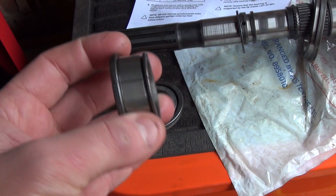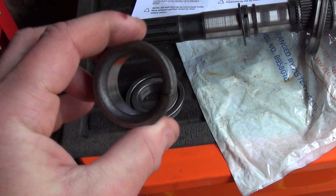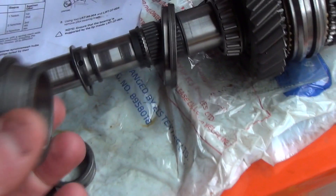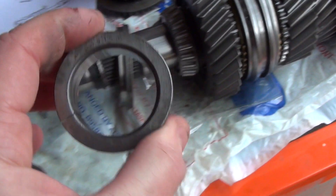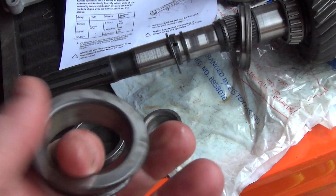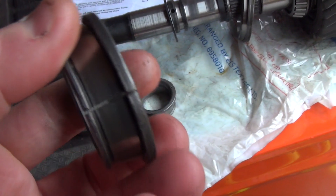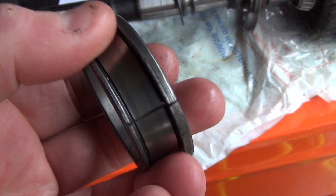One method I found quite useful was to take the old bearing. I've taken the collars off the other cages - this is actually one of the bearings that was sitting on there. I took this one off, removed the cage and all the bearing parts, and then I ran a Dremel down and cut a relief slot out of the ring.